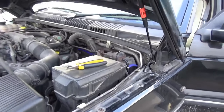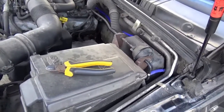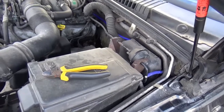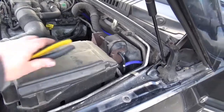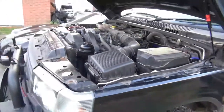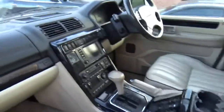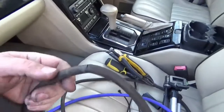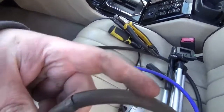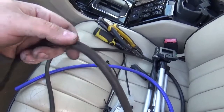That's the vacuum lines replaced, and they are the main culprit for faults on the old cruise control. Now I'm just going to button up that dashboard, take it for a spin, see if we fixed it. And now we're just buttoning everything up. That's the dash back together nicely, engine bay's all sorted. Just before the test run, you can now see where that damage was in that hose. So it wasn't as obvious as it could have been.